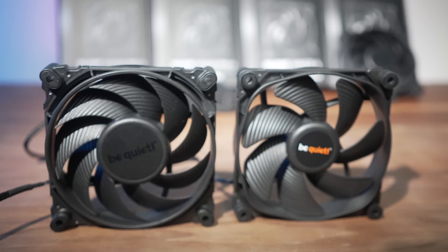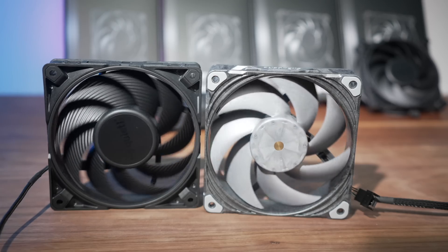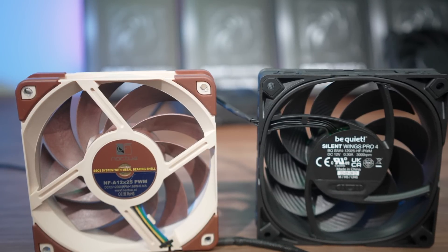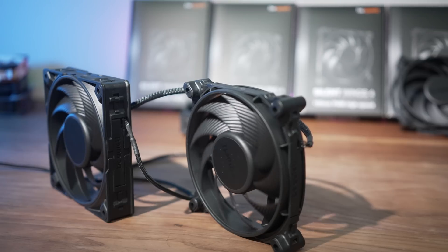These blades are a lot more curved, with lower tip-to-frame clearance, and you've still got those airflow grooves that Be Quiet puts on a lot of their fans. This design puts it a lot closer in appearance to the Phanteks T30 and the Noctua NF-A12x25. The 140mm version has seven blades; the 120mm has nine blades, just like the Noctua, although these blades are a bit wider. The construction is polybutylene terephthalate, a thermoplastic polymer, reinforced with 30% glass fiber. The blades feel quite supple but are not quite as thick as the Noctua or Phanteks.